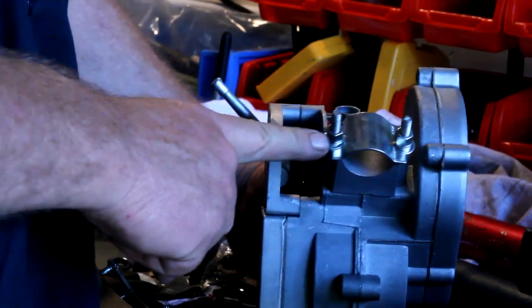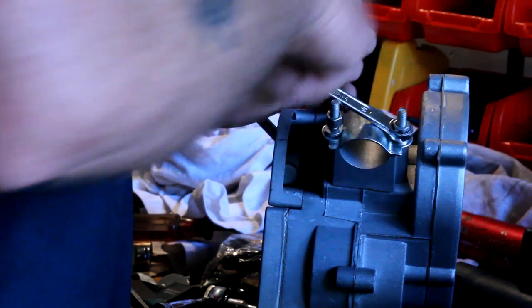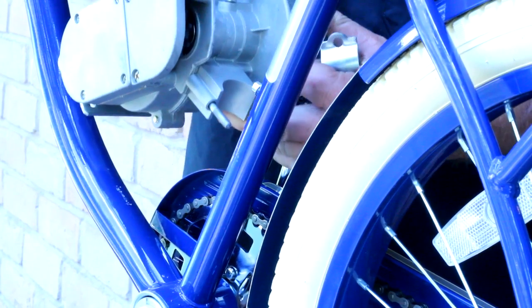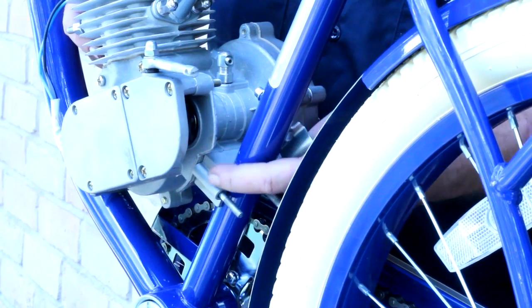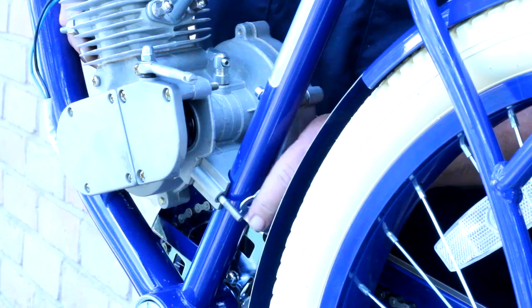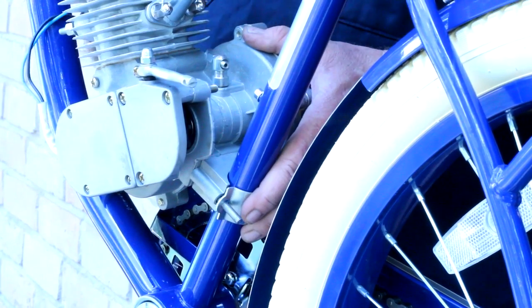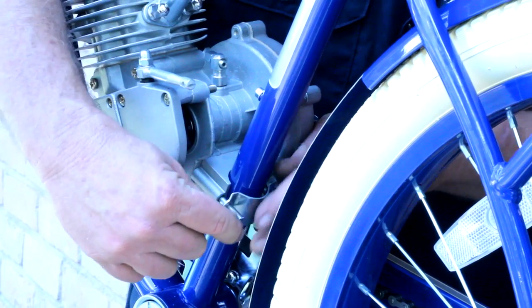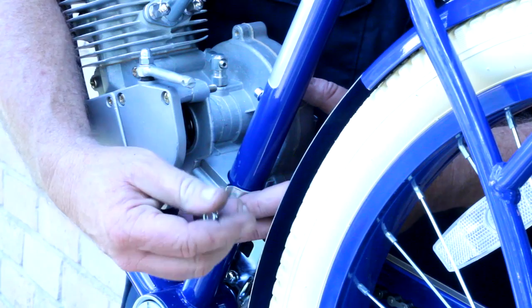You've got your front bracket on — now we need to remove the back bracket and remove the bolts. We're ready to go ahead and fit the motor onto the bike. We've got the back mount; fit that into place. You want to get the back mount firmly and snugly against the seat tube. Get the bracket and plate on. Put your flat washer on first, then a lock washer. We're going to use a nylock nut — you want to use nylock nuts on your mounting.